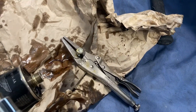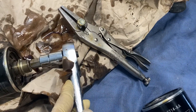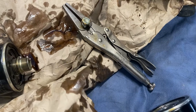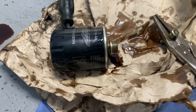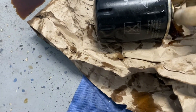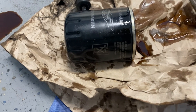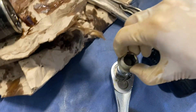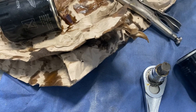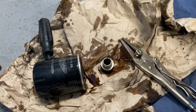I managed to solve the problem with an appropriately sized hex key I got from Harbor Freight. With a screwdriver jammed into the old oil filter — which I'll never need again — I was able to get the piece out. Then it goes back into the engine where it's supposed to be, tightened back in. It's actually something bigger than 14mm, but that was the closest I had and it worked. New oil filter going in — problem solved.